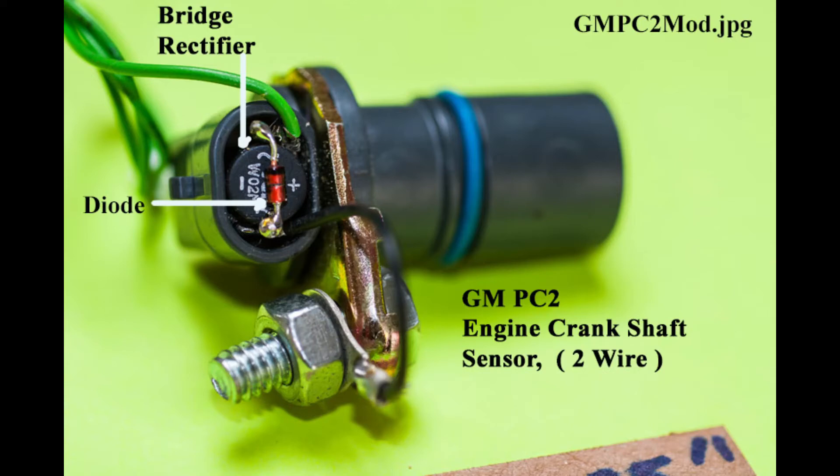This gives us a positive trigger pulse that is actually a doublet of two pulses. The induction coil PC2 has an output voltage that increases with RPM, which we need for RPM control of the spark timing. Voltages much higher than five volts would not be compatible with the LS2, so we just clip the top off the trigger signal at 5.1 volts, which is above the trigger level of the LS2. This requires a 5.1-volt zener diode. I'm using small components so I can fit them in the PC2 connector, but one could alternately use a small box.